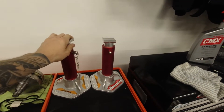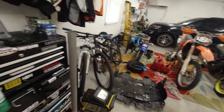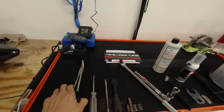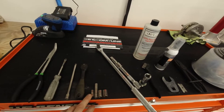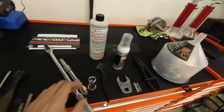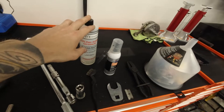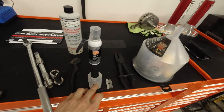As far as the tools go, you need a good set of quality jack stands, a good quality jack, and a drain pan to catch the coolant with for starters. For the actual tools themselves: a good set of long needle nose pliers, preferably angled; a flathead screwdriver; quarter inch extension socket; 7 millimeter, 8, 10, and 12 sockets; a breaker bar with varying extensions; 12 millimeter hex head socket; wire brush; some acetone to clean the hole out when you get the plug removed from the block; and a one-inch crow's foot.